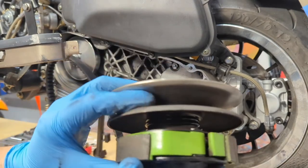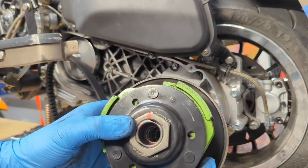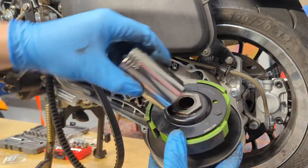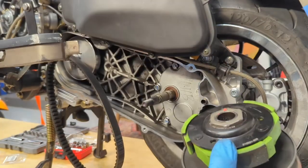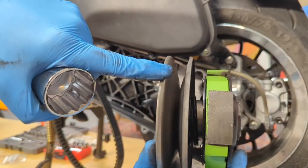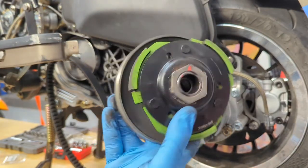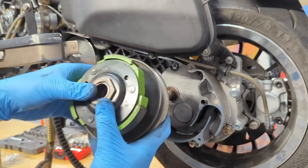The CVT belt rides inside the clutch pulleys which expand as the clutch engages. I've got the NCY clutch installed. To disassemble the clutch pack you use the 38 millimeter or inch and a half socket, step on it with your feet, and break it loose with the impact. There's a big spring inside holding the two plates together — fight that spring carefully when you ease it apart. We won't cover full clutch disassembly in this video but can make one if needed.